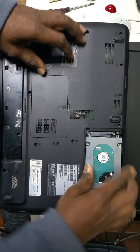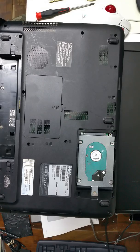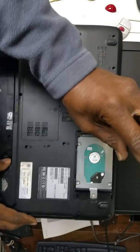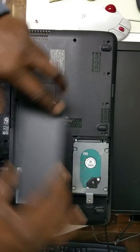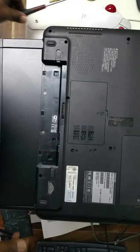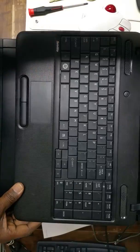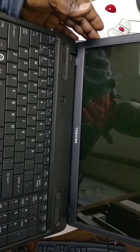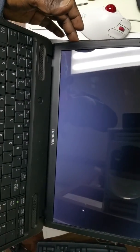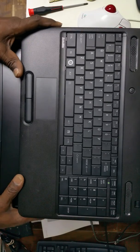Replace your hard drive, replace the screw that holds the hard drive in place, put the hard drive cover back on, and replace your battery. If the battery is charged you don't need your power cord at this point. Once you hit your power button, if the battery has charge, your unit will start to boot and you're good to go.